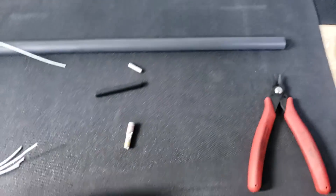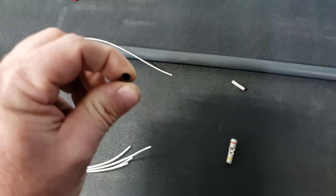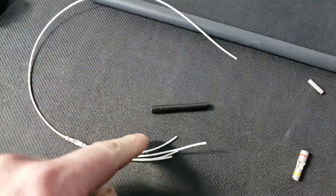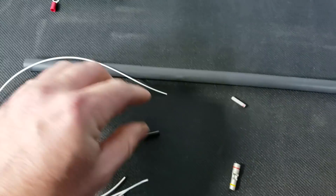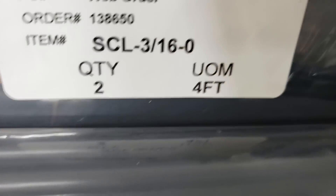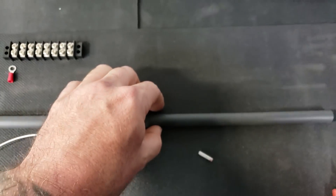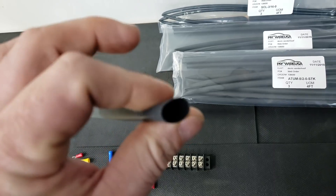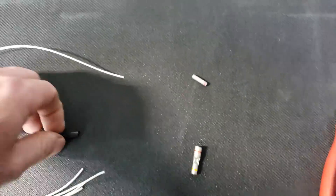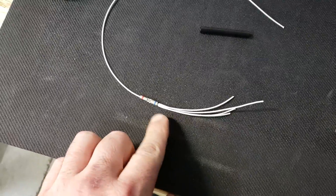One of the most important parts of doing anything like this is proper tooling and proper sealing. This stuff is a little more expensive than what you'll find on Amazon, but it's worthwhile. This is made by Raychem — it's a dual wall adhesive lined heat shrink. You can see it's very difficult to squeeze; it takes a good bit of effort. That's the SCL series from Raychem. They also have a less rigid type called ATM or ATUM — also adhesive lined but a lot more pliable and flexible. Whenever I'm doing a junction inside a harness I like to use the rigid SCL.